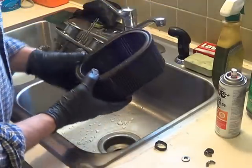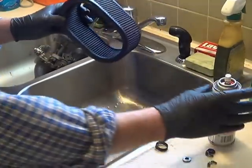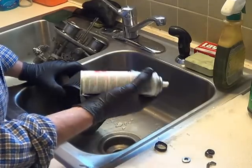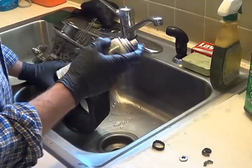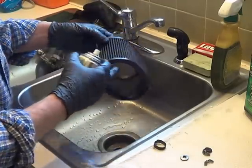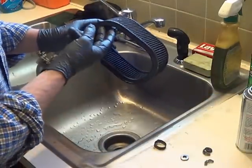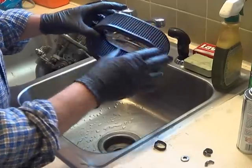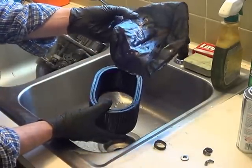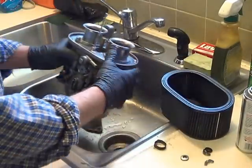Leave it out in sunlight to dry completely. You'll know it's dry when you flick it around like a lasso. When you recharge it, go from the inside and give it a little spray. This particular can comes out in a stream like silly string — I want a fan spray, a fog. You don't want it soaking and dripping; it doesn't have to be red. The oil will wick through it. Apply on the inside and when it goes on the carburetor it'll wick down and work well — and that keeps the outerwear from getting soaked with oil and crud sticking to it.